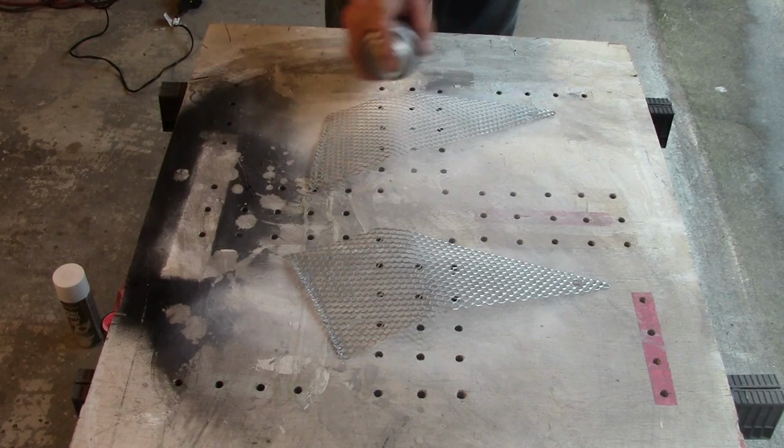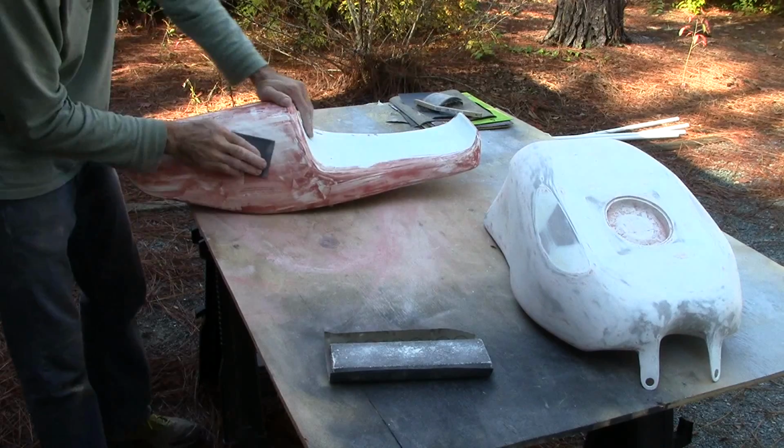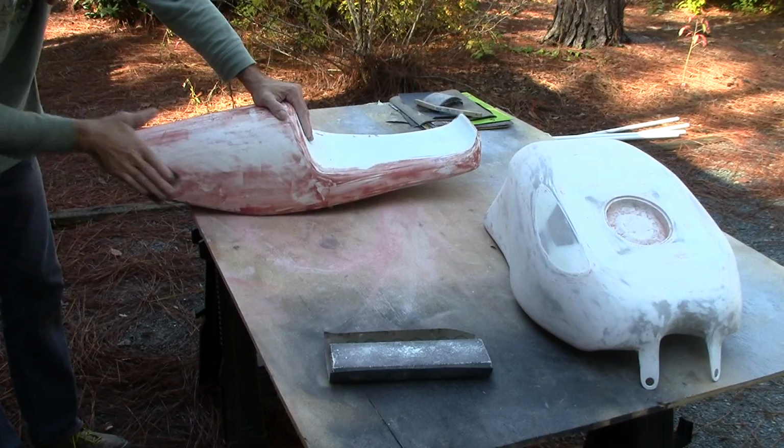Yep, that's right. One more time, sanding. Lots of sanding. Whew! All sanded. You can see here what the scratch coat does for you. It actually fills in little scratches that you wouldn't otherwise see all over the place. Little pinholes, like right there. All that stuff. Really important, because if the pinholes are still there when the paint goes on, it will bead up around the pinholes, and that isn't good.